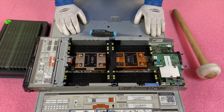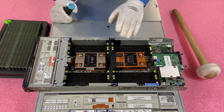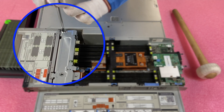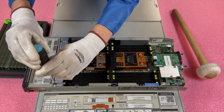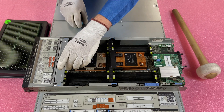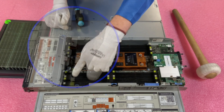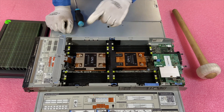Now that we have our ESD gear on, we're safe to operate inside the machine and prevent electrostatic discharge. First things first — when you're installing DIMMs into the second CPU, you're actually going to have to remove this cover here. There are two screws — just grab your screwdriver. One thing to note: these screws actually don't come out. You're going to unscrew it and it's just going to pop up a little bit but not fully come out. The ribbon cable is connecting it, so you do need to be careful. I try to just stick it up to the side so I have the space needed to operate inside the tabs. You don't want to pull it out because the ribbon is connecting it to the motherboard — definitely be very careful with that.